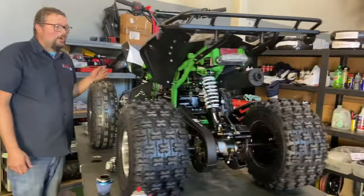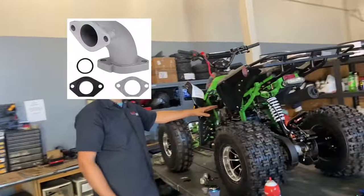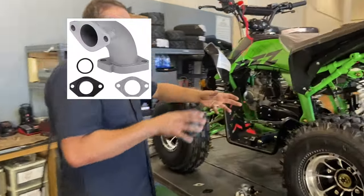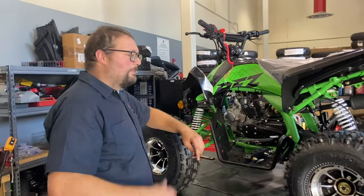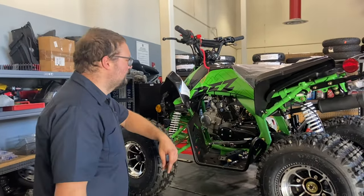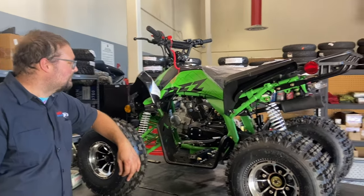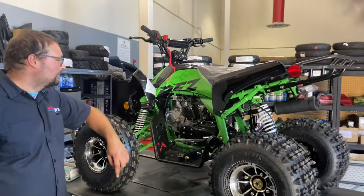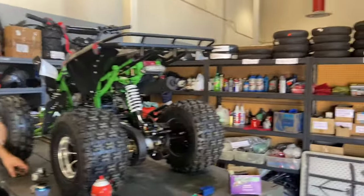For additional tips on the intake manifold — sometimes even brand new intake manifolds can have a pinhole creating an air leak. We've had this happen, replaced it, and it fixed the issue. So these are some fundamental basic tips. There could be other reasons why your ATV is not starting or is bogging down, but these are the fundamentals to get you started before you call your local dealer.